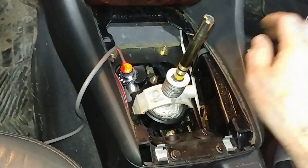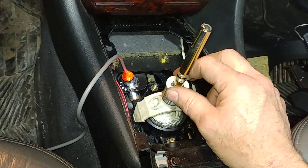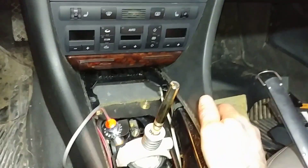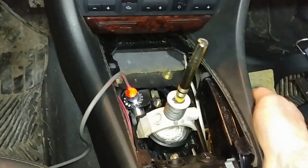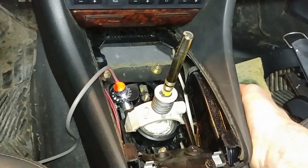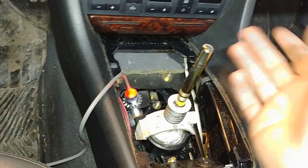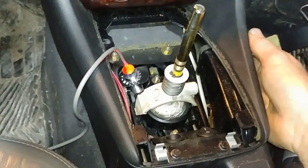These have worked for me in the past and it's my own personal car, so worst case I'll be chasing it down the road. I'm putting in this Viper remote starter — it claims about a one-mile range, though I highly doubt it, but it's got a long-range FM transmitter and is two-way. After about eight minutes or so there should be good heat coming out of the vents. I like to let the engine idle — it gets the oils moving and warms up the transmission oil, so it shifts much nicer right from the get-go versus getting into a cold car.